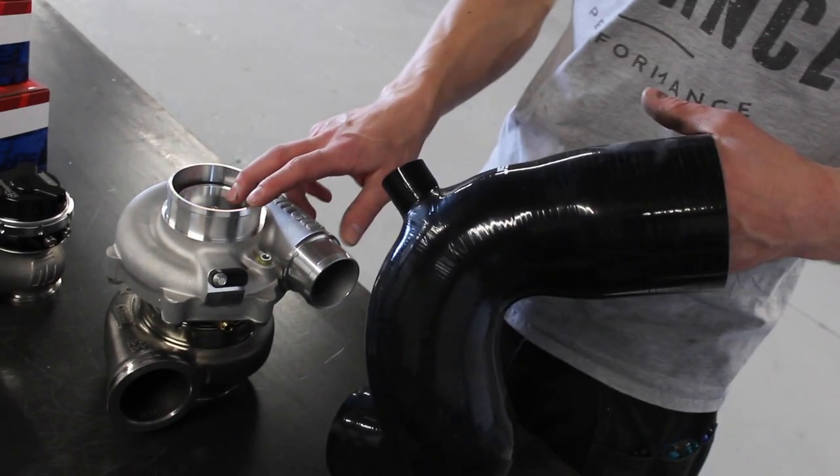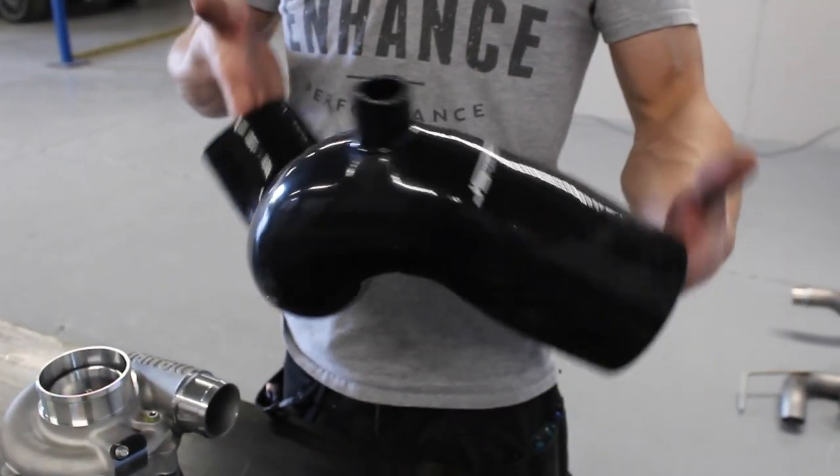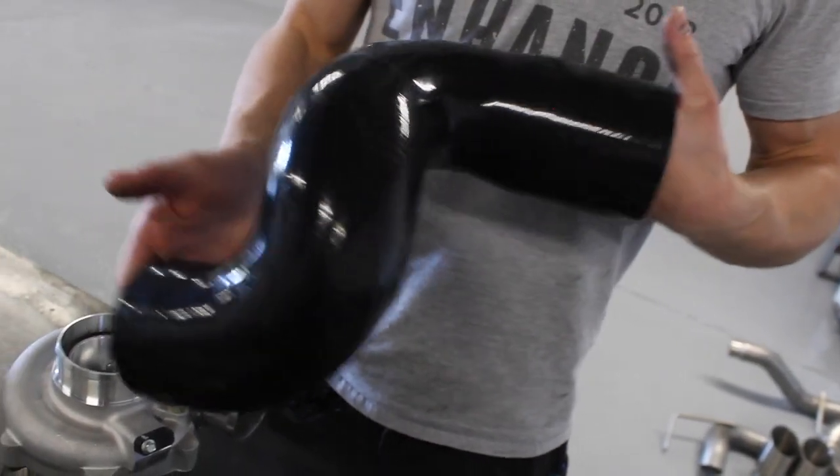Moving on to the intake side. The Garrett G25s, G30s, and G35s all have a 76mm three-inch intake. We've gone to great lengths not to compromise on the exhaust side with a three-and-a-half inch downpipe, and we really don't want to compromise on the intake side either — that's why we've got this really tight, twisty, weird-looking hose. What would be ideal is a solid intake pipe from the turbo to the top, but clearances behind the back of the engine are really tight. It was important to maintain that three-inch bore all the way through the bend with no more than a three-inch centreline radius.